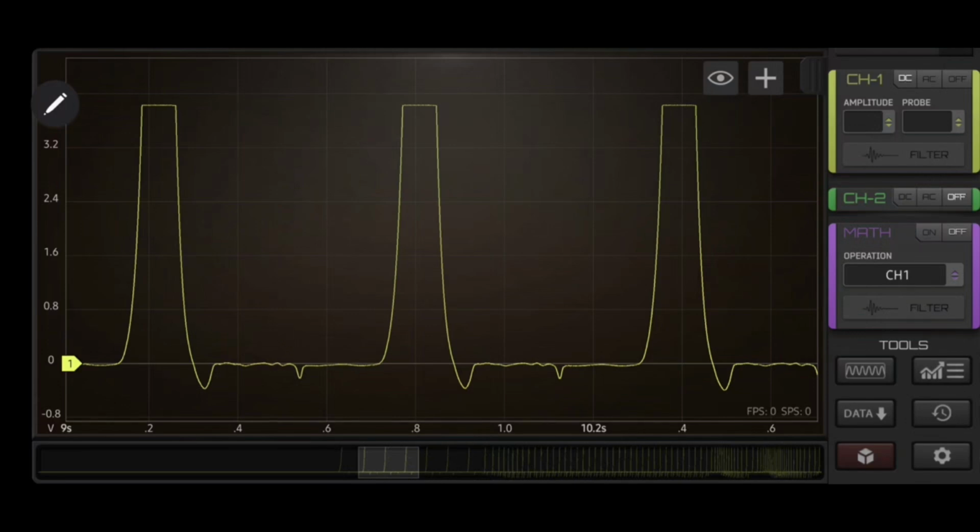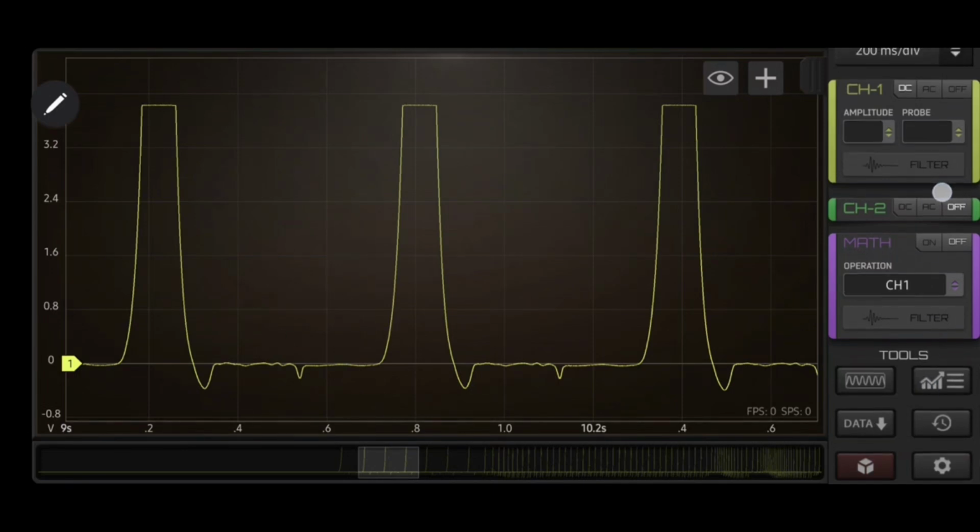But like I said, you have to do that with the throttle plate shut. That way you actually create that vacuum, and you can actually see that creating vacuum against that throttle plate, because if it's open, there's no vacuum there, so you can't really tell what your exhaust valve is doing. So I thought that was pretty cool.